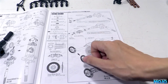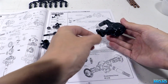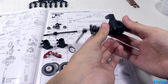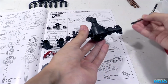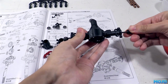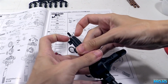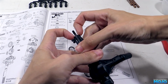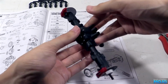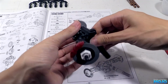Even the axle shafts are the same as the front, complete with their CV. It might have been nice to have solid ones, but I'm sure they're going to work just fine. The other minor difference is they don't have us fit the lower link mounts, so rather than having to remove them again later, we just fit them along with the links. I'm thinking the front axle build might have been a mistake or oversight that never got corrected. When the axle's complete, it does look rather snazzy, just like the front. I think the calipers and the brake discs really make the difference.